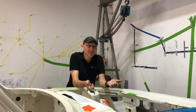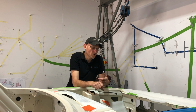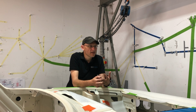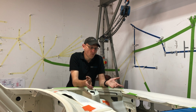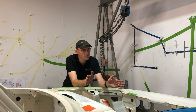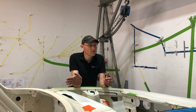Yeah. So I mean, it's kind of already out there, but having to put cooling into the battery makes it more expensive, less reliable. Yeah. I mean, you've got water running around inside your battery. You need a second low temperature radiator in there. There's lots of negatives towards it that we as a company have said we don't want to do that at the moment, right? Yeah. It will come, and I'm sure the customers will demand it. But for the moment, the way that you want to use your car, after you've driven 150, 180 miles, you will want to stop and have a cup of tea.